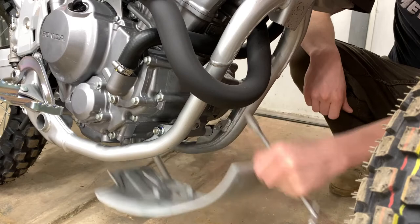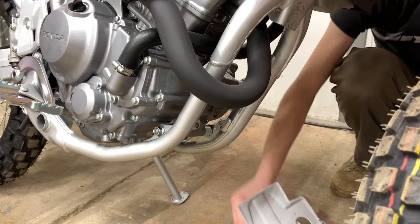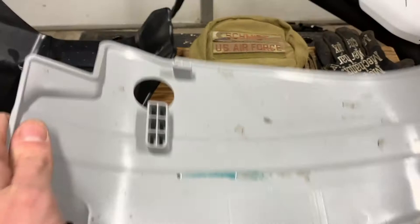Interesting — there's a drip of blue on there. That is from the coolant, so it looks like I, like everybody else, seem to have that same coolant leakage problem out of the weep hole. In case you are curious, the original factory skid plate here, as you can see, is made of polypropylene, which is not the strongest or best plastic for this sort of application.